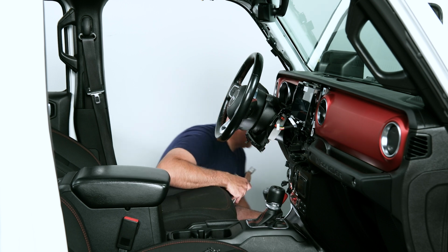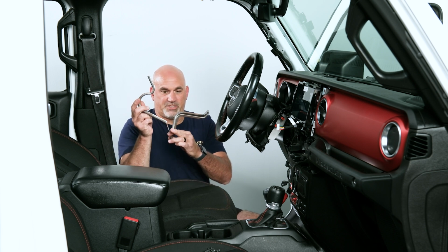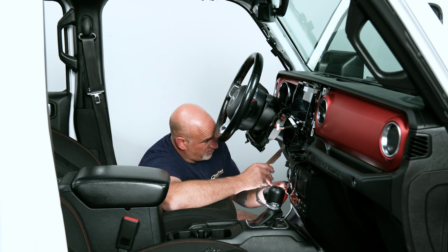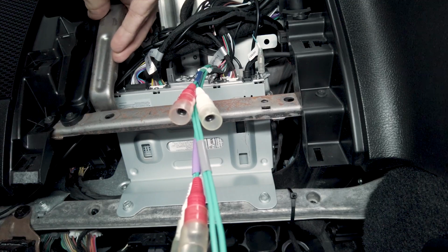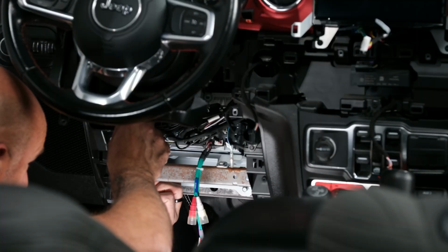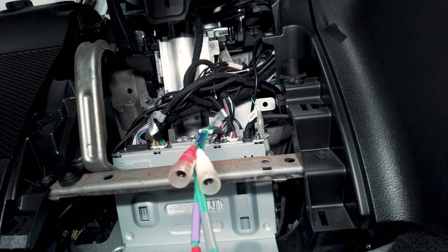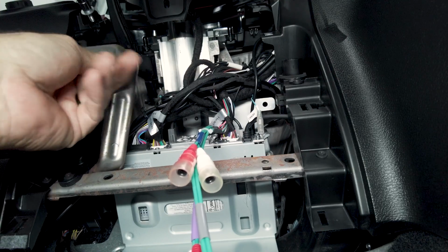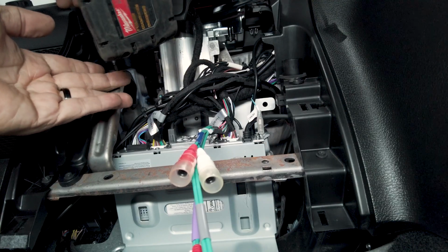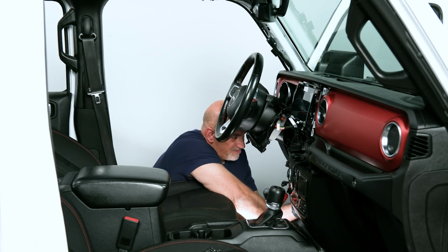So they will be two different shapes. So this is your driver's side. This is your passenger side. You'll notice there's a little clip here. So that will kind of remind you that it's the passenger side. So first we will slide this up in. Grab our 10 mil from the bottom. Get that started there so it stays. And then we can grab one of our 8mm bolts. And now that's locked in. Switch over the 10mm and tighten this one up.